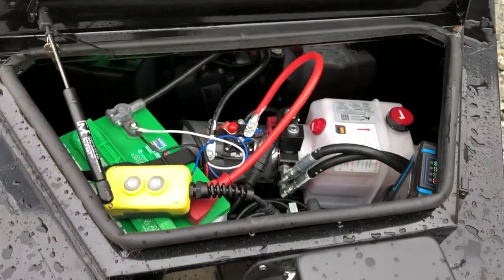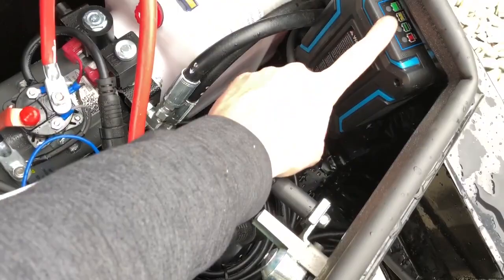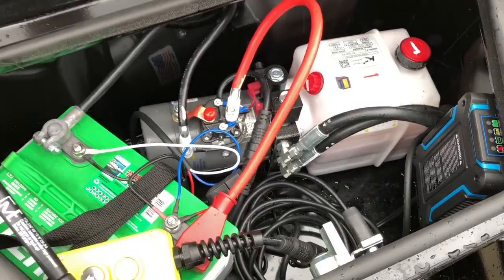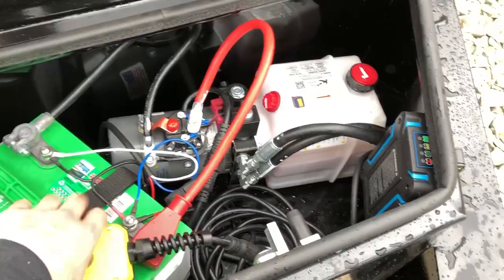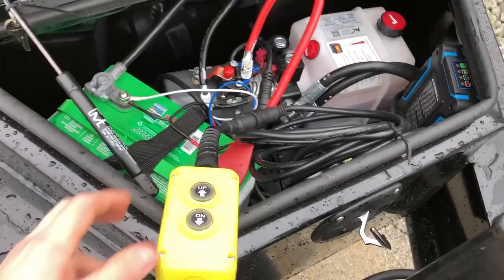It's got an Interstate battery and a KTI pump — power up, power down. It's also got an integrated 110-volt charger, so you simply plug this into an extension cord with house current and it'll keep your battery maintained. Note that a lot of these battery trickle chargers are 2, 5, or 8 amp. Being that these are 140 amp-hour batteries, you're going to need to charge the battery more than overnight — generally something like this you'd want to leave on for a weekend. This has a 20-foot all-weather remote cord designed to be long enough to reach your truck. We do have wireless available for these as well if you would prefer wireless.